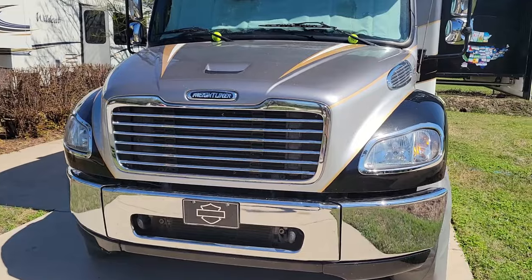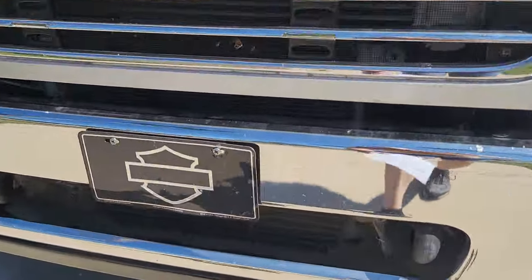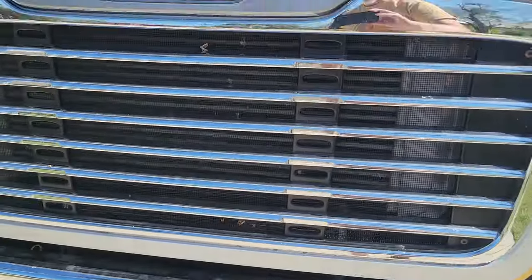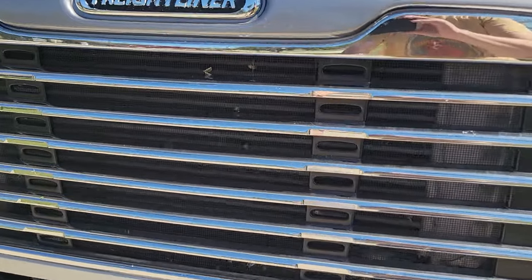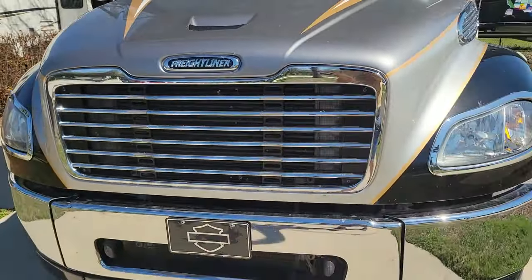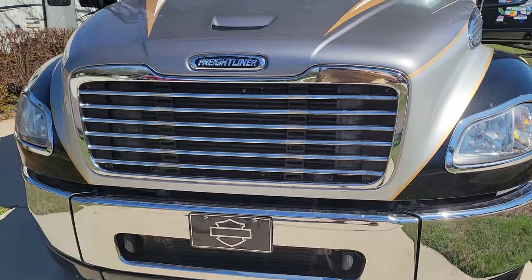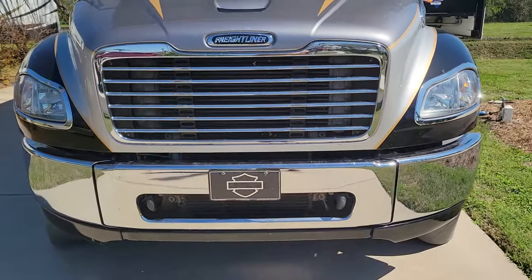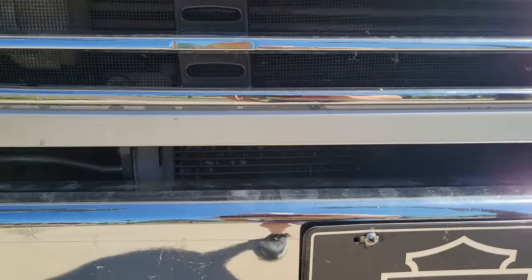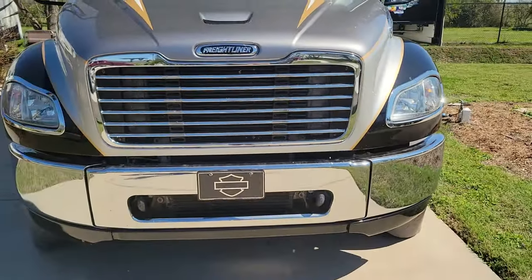For starters, I have a screen on the grill. Down here is just a regular window screen, and that's exactly what I had there. But Jayco finally came out with a black one that I went ahead and put on while we were at the Super C rally. It really saves the radiator - you can really tell the difference looking at the radiator condition versus behind the screen. Highly recommend you all do that.